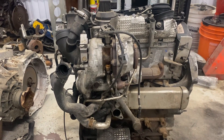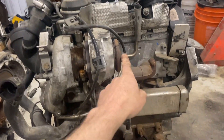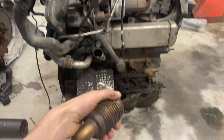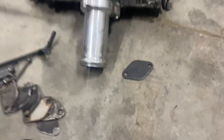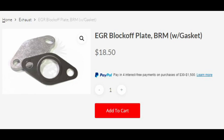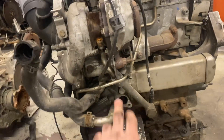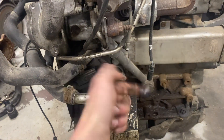Next we're going to do the low pressure. We've got two options: one is extremely easy, and one is not as easy. Since we've got our high-flow down pipe, we no longer have room for our EGR filter that would bolt right there. So you can install a little blocker plate there — the narrower and shorter ones found on the BRMs and apparently the CJAA EGR coolers. Quick and easy: you bolt that on there, flash your tune, and that valve's going to stay shut.